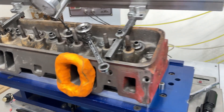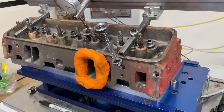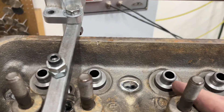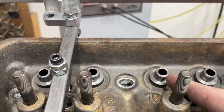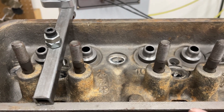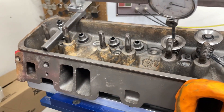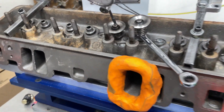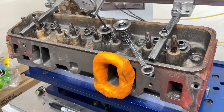He got these and painted them just to keep them from rusting. He went ahead and did a valve job, did a couple other things. Had them trimmed down as guides so he could put a better seal on, and he gets more clearance. He didn't pin the studs or nothing — these are stock ones. Now they do have hardened seats, and I'll show you in just a second. But he's just trying to do a mild engine with them.